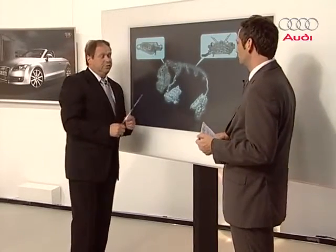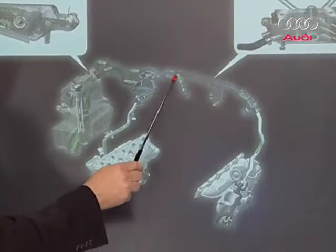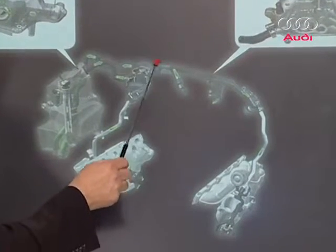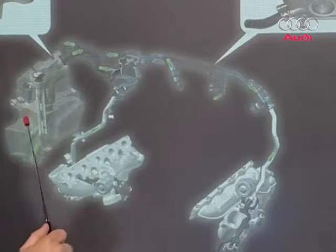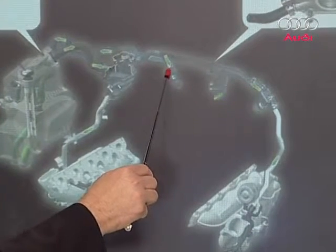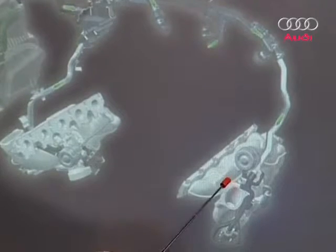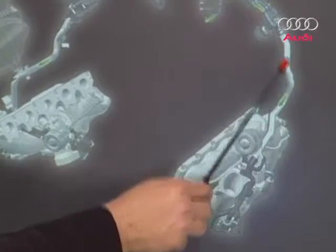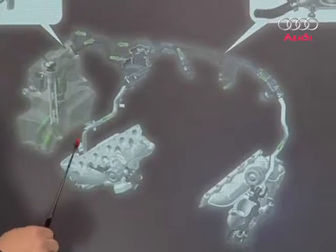Let's look at full throttle. In this state there's no vacuum in the intake manifold but high pressure instead. If there was no non-return valve here, the charge pressure would push against the current and repel the blow-by gases rather than draw them in. So this non-return valve closes. At the same time there's a vacuum at the intake end of the turbocharger because the flow rates are relatively high, so the non-return valve there opens and the blow-by gases pass the intake end of the turbine, sent into the intake manifold via the charge air line. The same thing happens on the other side.